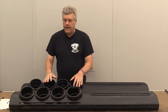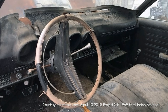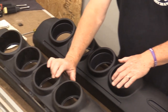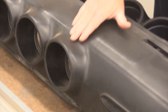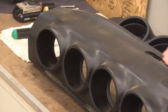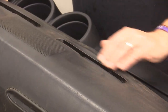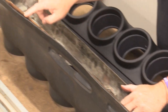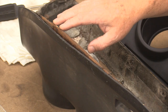One of the big problems these original dash pads have — now some 50-odd years on — is that they are starting to shrink from being out in the sun. The picture I'm showing you right now is of a dash pad from probably a car out of the west or southwest where that dash pad is just trashed. This one wasn't in Texas and it's starting to show some wear and tear. You can look at this and see that on the top right here it's caving in and it shouldn't. This should not have a dent right here, and it does, and that's happening on all four of these pods. The vinyl is pulling away from the metal backing. This is not an uncommon problem for these 68 and 69 Torino and Fairlane dash pads.